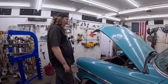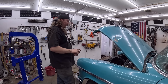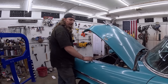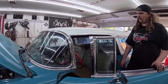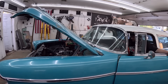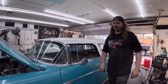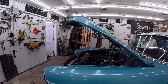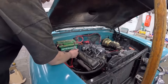I think I've got everything together. I did not fix any of the tail lights — the lights are — we also lost headlights. There's been a bunch of things here, there's some electrical gremlins, but we've got 12 volts run to the alternator. So we'll just see if it fixes itself. The gen light is still on, but we didn't run the power to it, so maybe that's why. But we have 14 volts at the battery, which means it's charging.